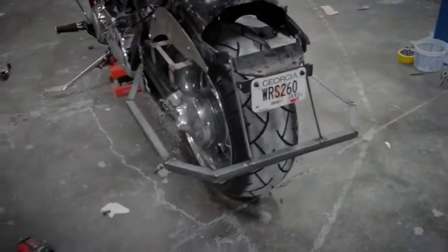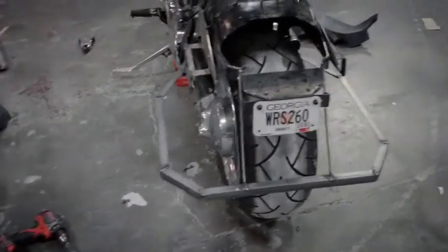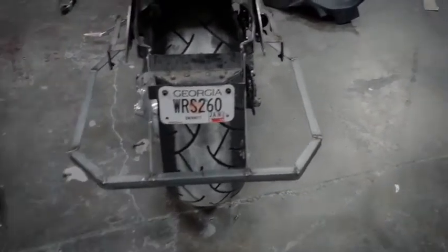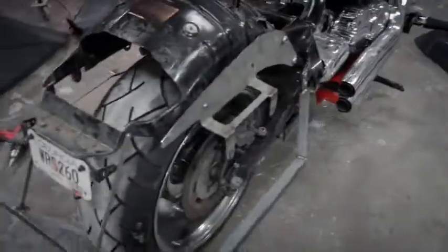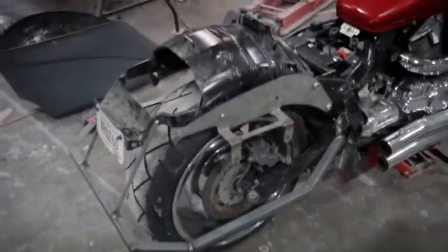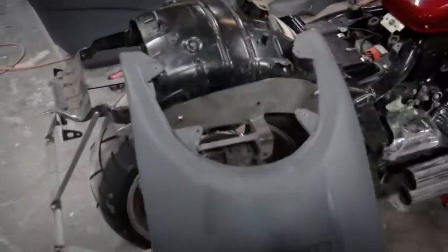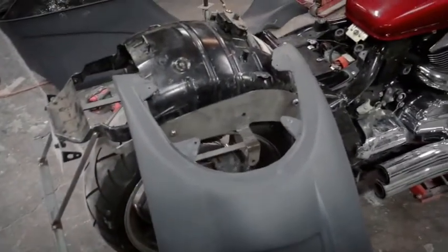The rail is now supported using the 6 bolts talked about. It usually sits pretty much level around the bike. That's how that's going to line up. So the next thing we're going to do is mount our fender that is right here to the back of the bike. This is going to attach using the 4 holes up top like the stock one. So we're going to go ahead and bolt that sucker up.